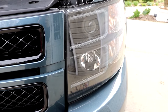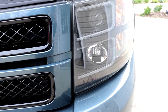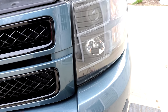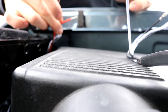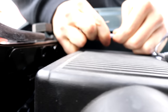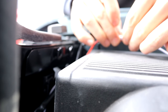Just look how cool those look — I can't wait to see them when they're on. I'm thinking about going with LEDs or HIDs. I know HIDs would be a lot brighter, but I don't want the risk of getting pulled over for something so bright. Plus they're more delicate and fragile. LEDs would be a lot cheaper. I don't think I even need to run a harness — I'm just going to rig this side onto these connectors, the same ones I used with the fog lights. I got the black and red wires, and I'm going to take another red one.